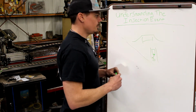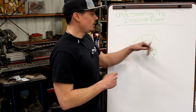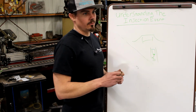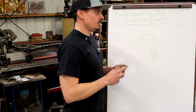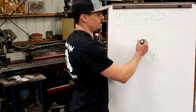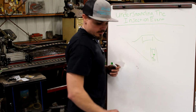Usually you got to put a lot of pressure in the system through RPM and boost pressure to get long duration events to work. So that's why you see laser cut DVs, full cut DVs, really hard to tune, especially if you got CCs, could be nearly impossible to get to run clean down low because you get this long duration event. But the duration isn't necessarily long either.